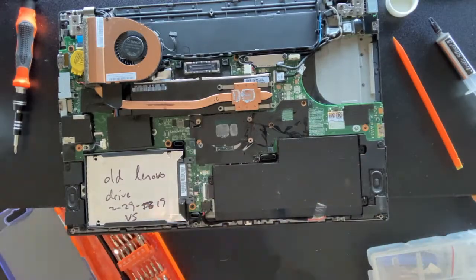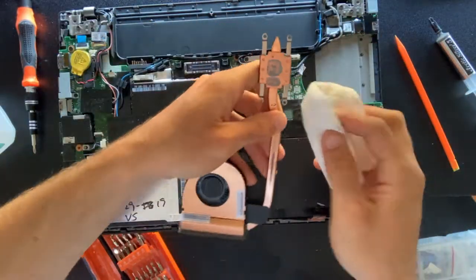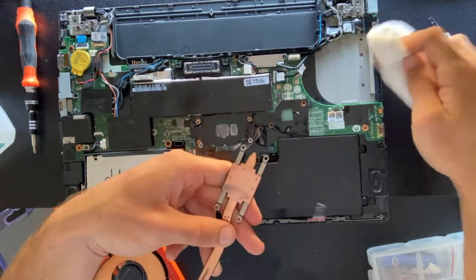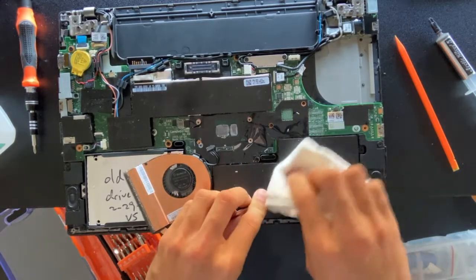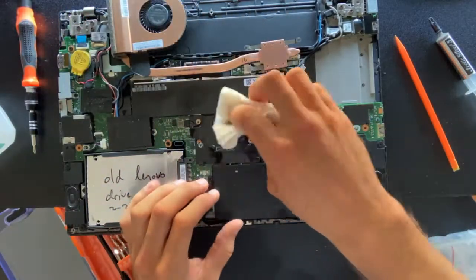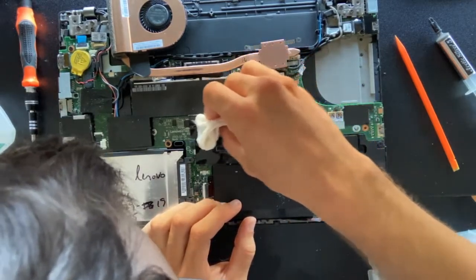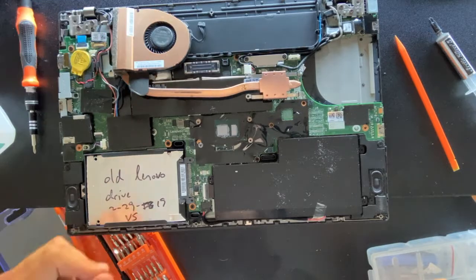The more crusty buildup you have there, not good. I'm going to use a cloth and some ethanol to clean off the old thermal paste, both from the CPU cooler and from the die on the CPU itself. Interestingly, some ThinkPads only have one location where thermal paste contacts the cooler, but mine has two — that might be the CPU and GPU, or some other architecture. This is a ThinkPad T460 and it has two dies that you need to get cleaned. It's mostly just the surface of the chip and the surface of the cooler that you want clean and free of oils.